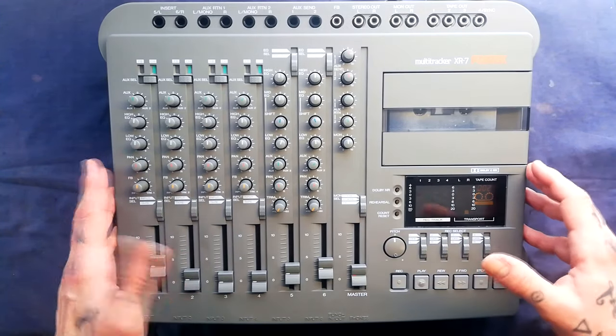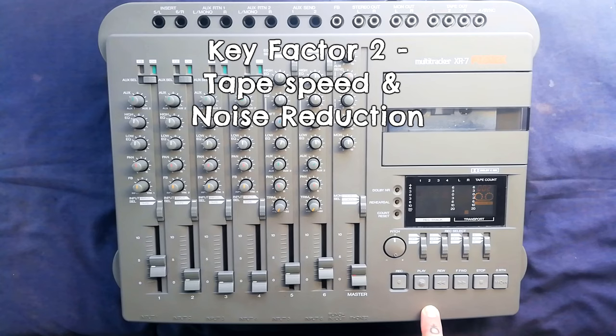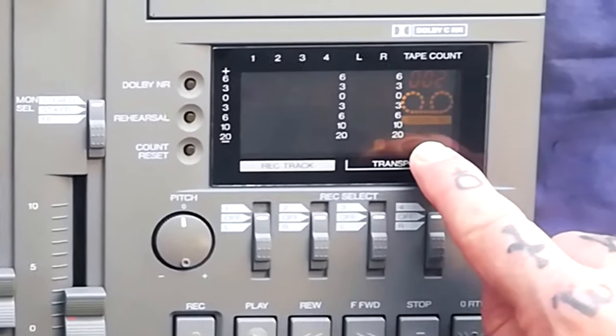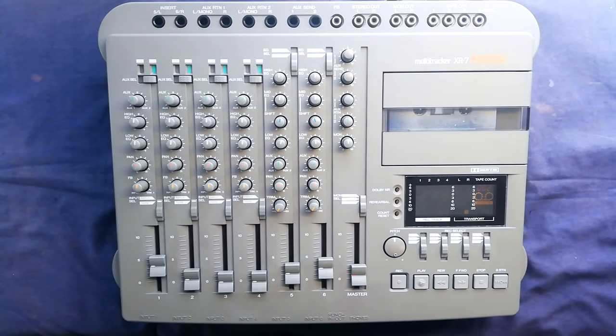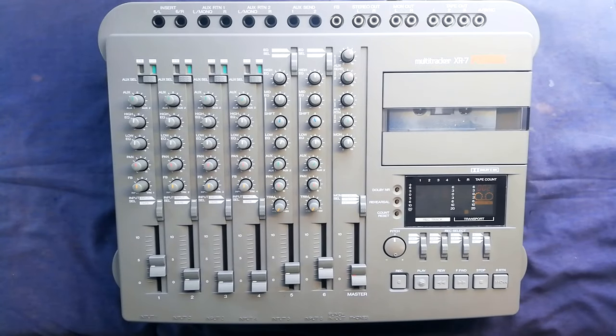A little bit too big to fit into a backpack, but if you had an appropriate case you'd get it on public transport no problem. It is dual speed — it's not completely obvious that it's dual speed. What you have to do is press the rehearsal and stop button simultaneously, which means the rehearsal light on this backlit LCD display will flash, giving you the lower of the two tape speeds: 4.8 centimeters per second or 1⅞ inches per second. Press rehearsal again and you're at 9.5 centimeters per second or 3¾ inches per second — double the speed of something like a Walkman or home stereo cassette player. That gives you better fidelity through a lower noise floor and better reproduction of high frequencies, at the expense of running through the tape twice as fast.